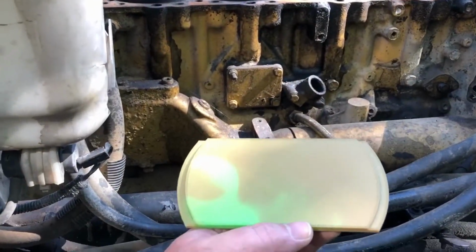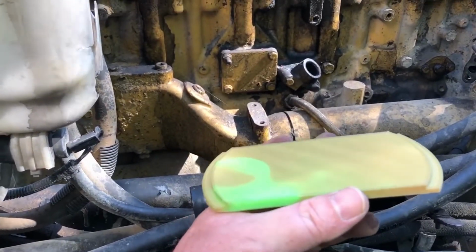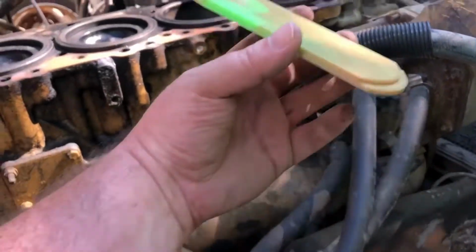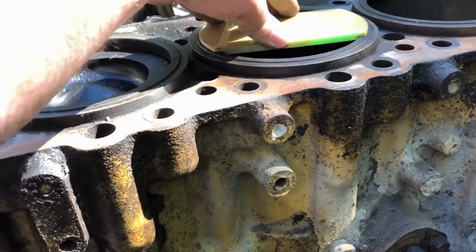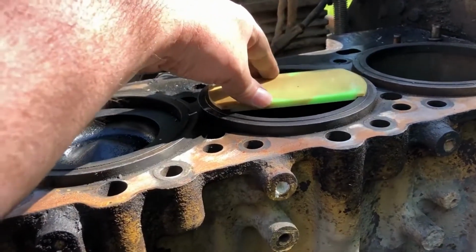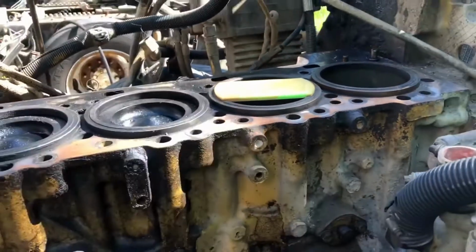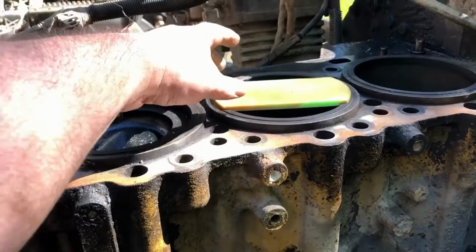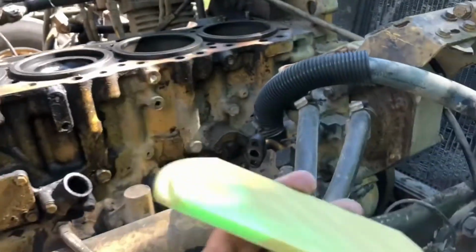But I just want to make sure that this fits, because what I found online was the bores were 5.3 or 5.4, so I made it 5.3. So let's see if this is going to fit. Yeah, there's a little more clearance there than I planned for, but that should be enough. And even the lip is fine. So this will be made out of steel, obviously.